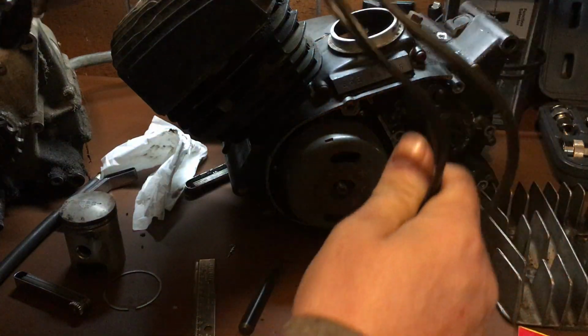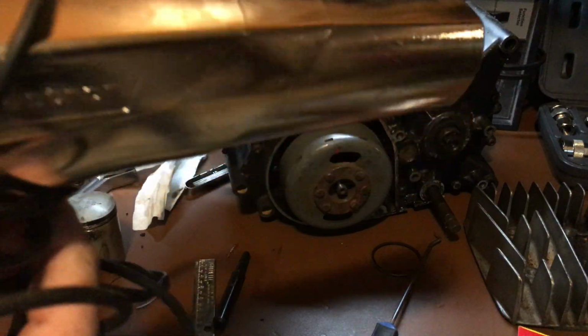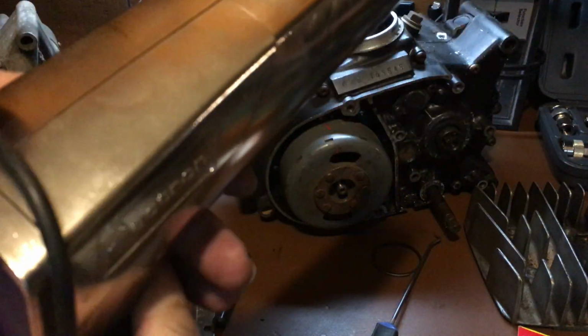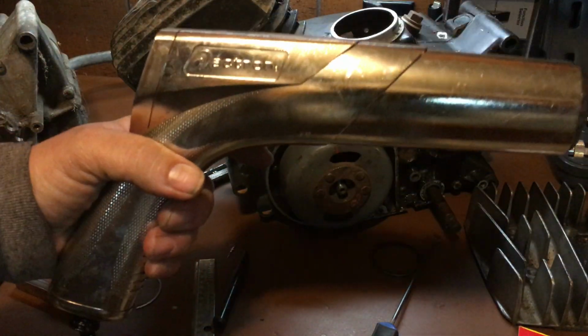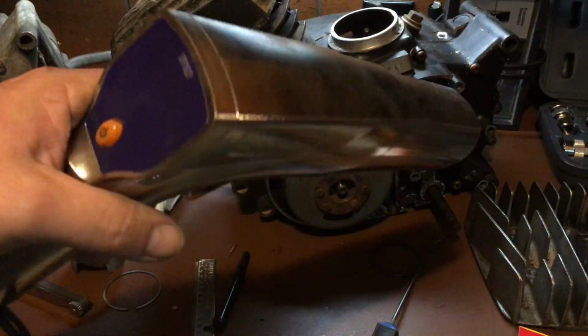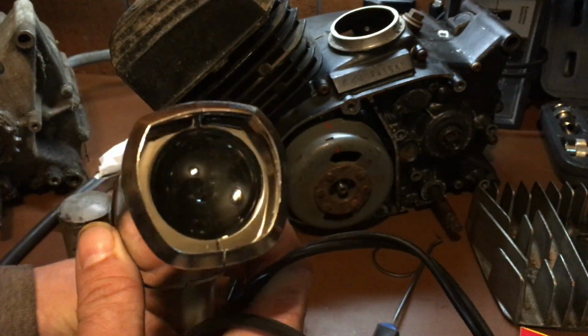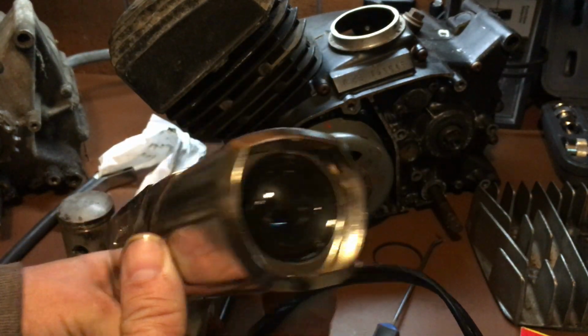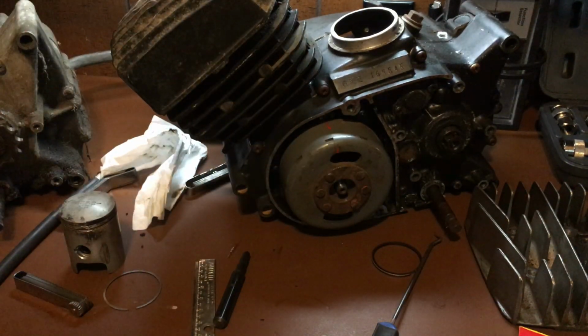I'm going to show you what this is. Got my gun here. It's my fully automatic, high power. This Star Trek looking thing is called a timing light. You can get these at an auto parts store. You can rent them. It's got an on and off button right there. And guess what? It's just a strobe light. That's all it is. It flashes every time the spark fires.